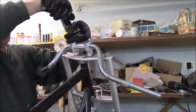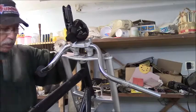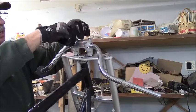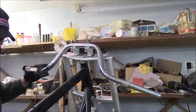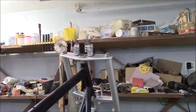You start out with a base coat, and then you hit what I do. It's pretty simple. You paint big blotches of like green, brown, black. Then you lay your first layer of stencils on there, which can be twigs and branches of all sorts, leaves, and then you spray, and it leaves the silhouette of that particular leaf or item behind. Then you lay some more twigs over after that's done in different directions, and you spray another layer around those and so on and so forth until you get a very nice 3D effect. And it looks really cool. I did it on some hunting rifles.